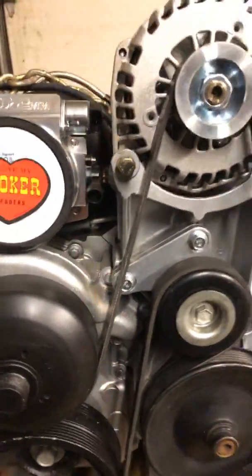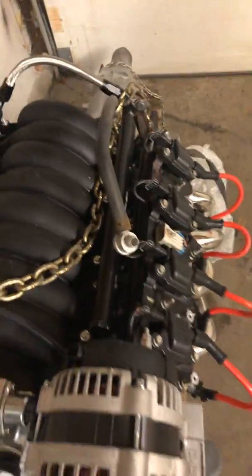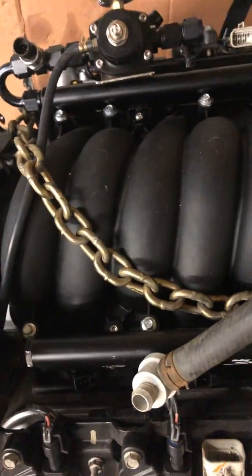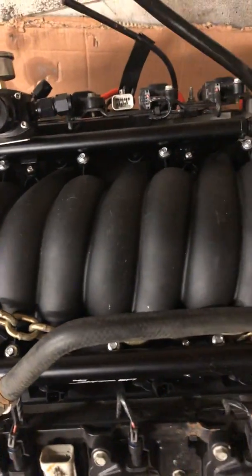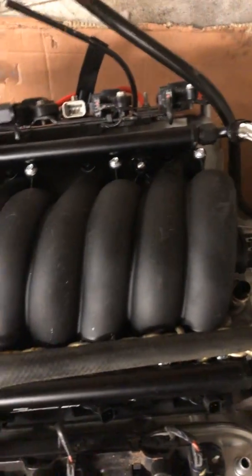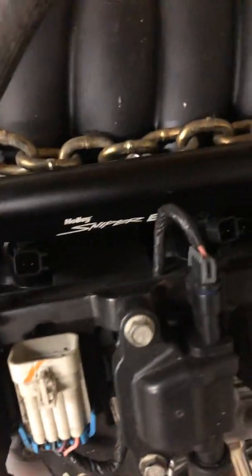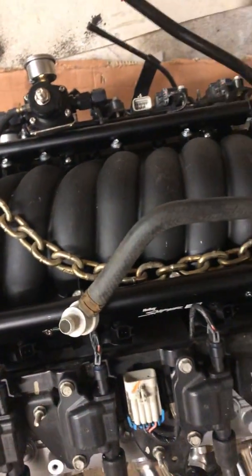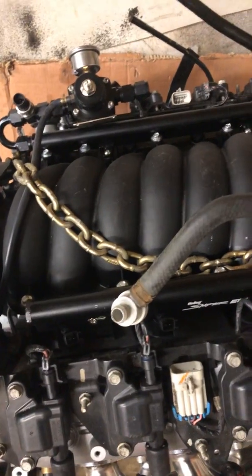Other things to consider with the fuel injection system — my first issue was that the stock truck injector fuel rail does not bolt onto the LS3 intake manifold; the mounting bosses are in a different spot. I could have modified it, but I saw these Holley Sniper fuel rails on eBay at a reasonable price, so I picked them up. I have 42 pound-per-hour Bosch fuel injectors installed.